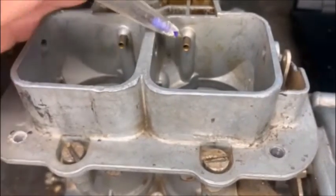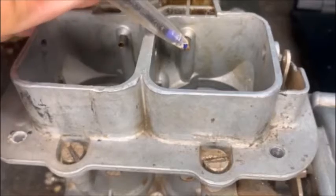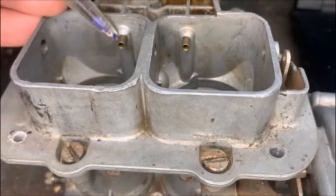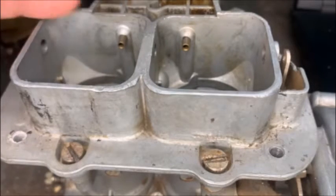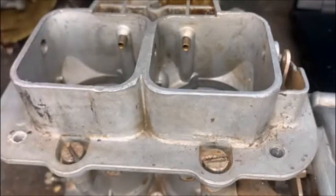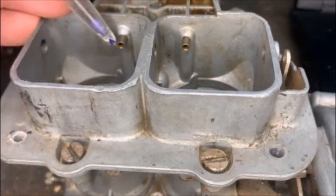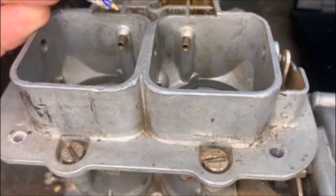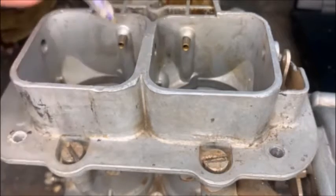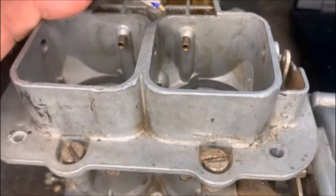Just be mindful of it — that can give you a lot of headaches. In the carb top, those are the two enrichment tubes that you saw in the drawing. I believe some of them have a calibrated bush inside there. If you rev it up and open the second choke you'll see fuel squirting out of there, which gives you more fuel on your second choke. When you use this on a small vehicle it can give you hassle. Out of all the carbies I've done, I've only had one that gave me trouble.